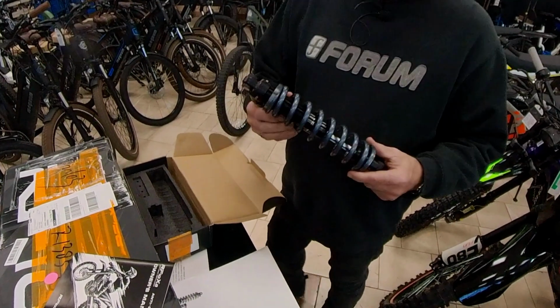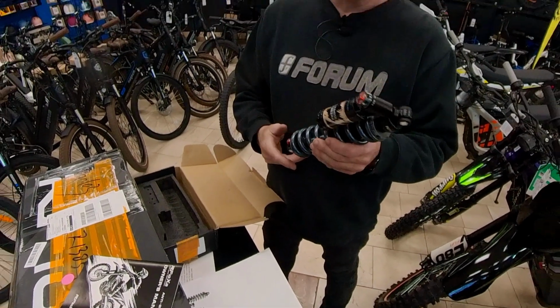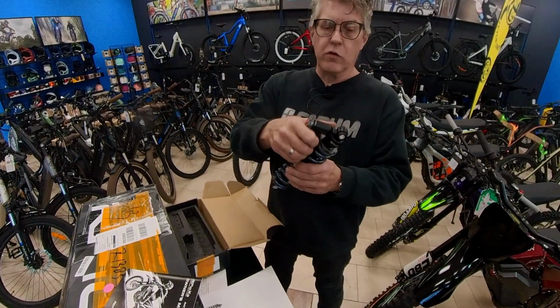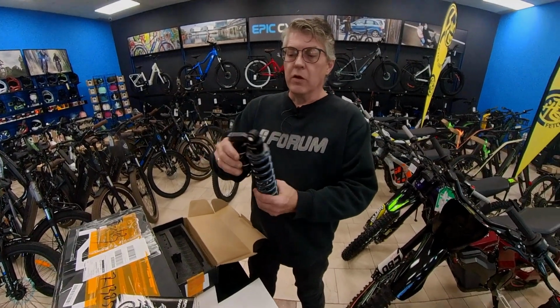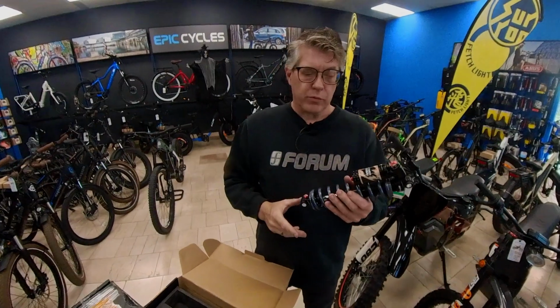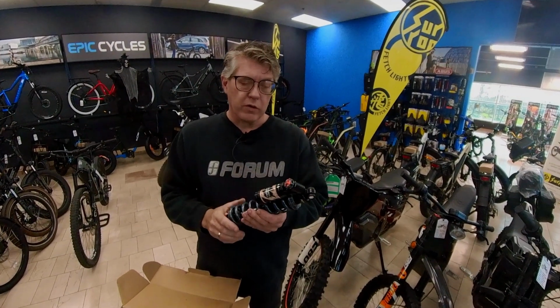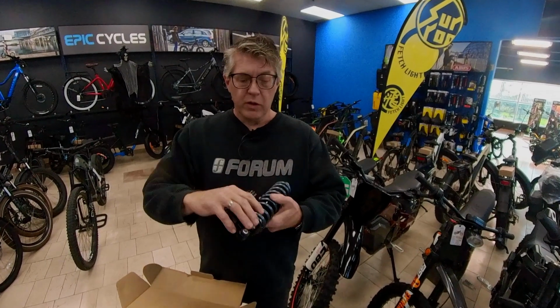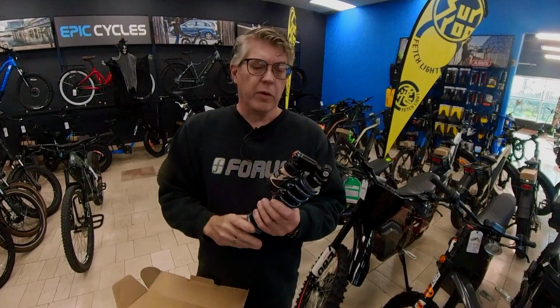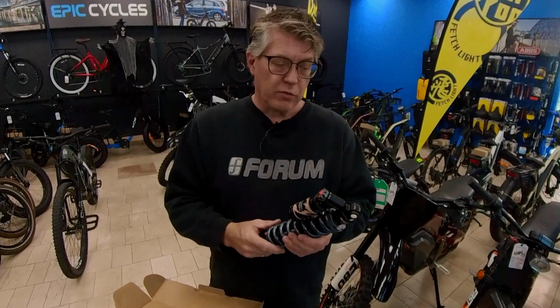So when we're placing this into your bike with this piggyback, if your shock already has one, put it in the same configuration. If you just got a standard coilover with nothing, just remember that you got moving parts, so you don't want your swing arm or other linkages to collapse or crash into this, or this thing to hook up on something. It can be mounted upside down, it can be mounted vertical, backwards, whatever suits the geometry and the placement in your frame.